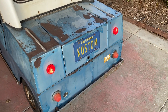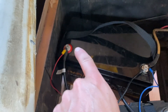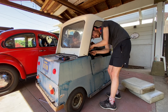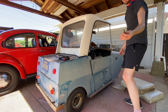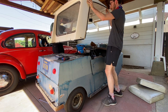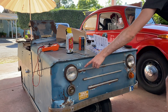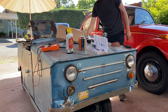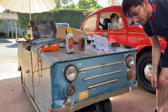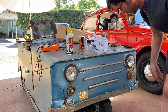We've done some troubleshooting and the tail lights work — not really sure what I did. All I've done here is got a positive there and a negative there, so that's progress. We had to run a negative because this has no ground — every single ground is rusty and crusty. So we're just going to run a bunch of blue wire. But we've got a headlight, so that's neat.